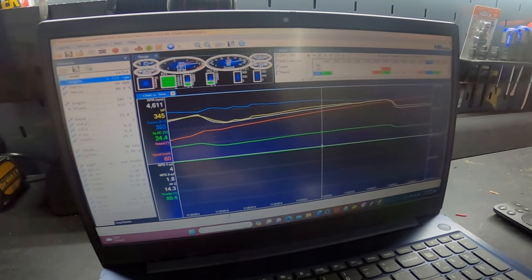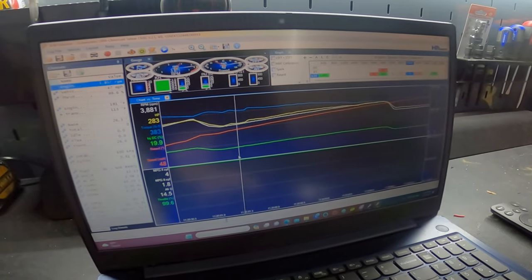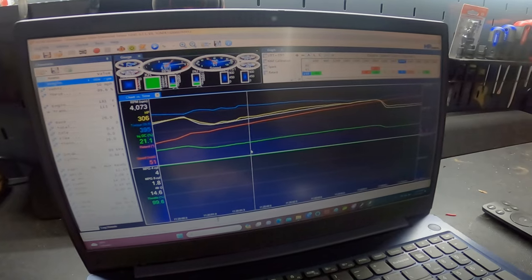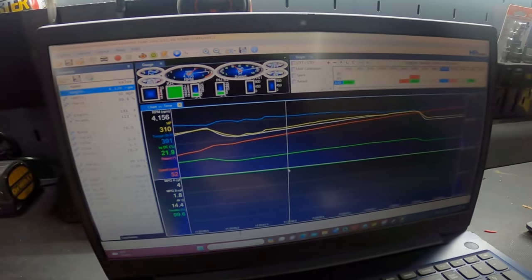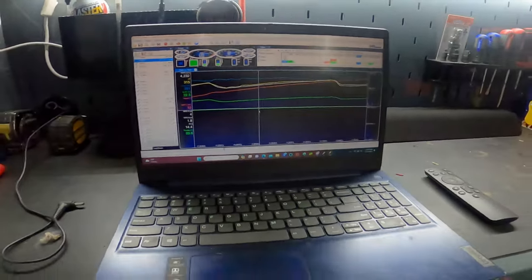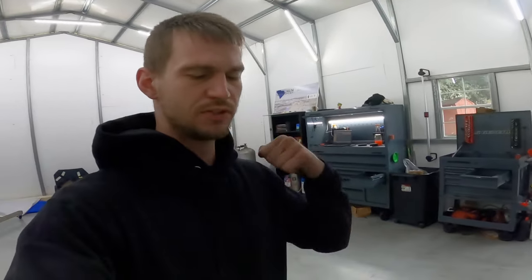And looks like the torque curve is pretty flat, because like I said, it's shifting early, it didn't carry all the way out to where it's really starting to fall off. But yeah, it's looking like 390 foot-pounds of torque. So pretty dang good for a stock motor. And like I said, get the fuel trims and everything squared away, and that'd be good. And start adding some timing into it. But yeah, truck is running awesome. I'm happy with it.